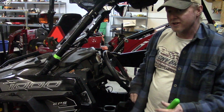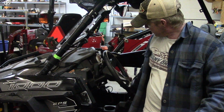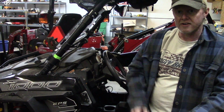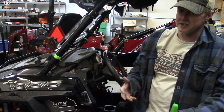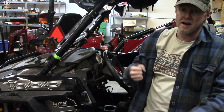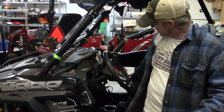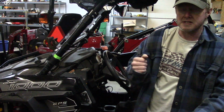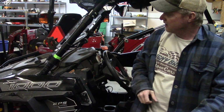One thing I'll say: I've got in a habit, especially with low range. If I want to get into low, usually I'll go all the way down anyway and come up. I've caught myself doing that already on this shifter. So if you're looking for one of these, and you really want the reverse, neutral, low with a high lockout, just keep in mind it's really easy to still shift with this particular pattern, because really the main thing you're interested in is that positive stop on the neutral. Low isn't that hard to find. Worst case scenario, you can always use high.